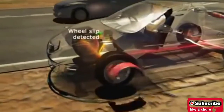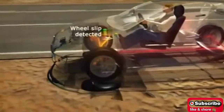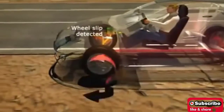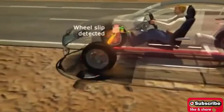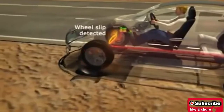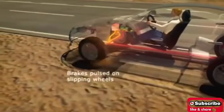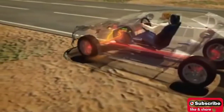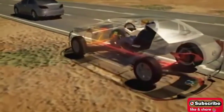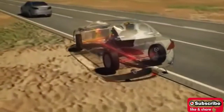The Electronic Control Unit has the module of the Traction Control System in it. It compares the rotational speeds of drive wheels of the vehicle with the help of the wheel speed sensors of ABS. If any of the drive wheels is rotating with exceptionally high speeds, then the TCS considers it as the spinning of the corresponding wheel and immediately sends a signal to apply brakes to that particular wheel.